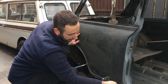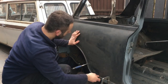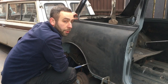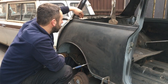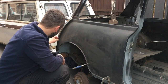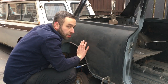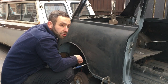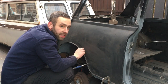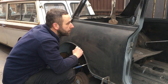It fits really nice there - back in with that profile, it just needs tapping back a little bit to go right back flush, and all the way along here fits quite good. Fits really nice here with the panels we've put in, so that can obviously just get welded from there. There's a little triangular shape that I've got to make so I'm not too bothered by that. I do want to try and spot weld this in but really if I get the time I'll just crack on and plug weld it - it's just as good, just means tidying it back. I just want to get this panel on and get the car together since it sits outside.